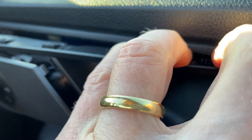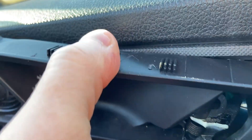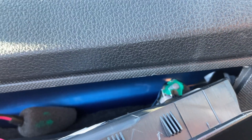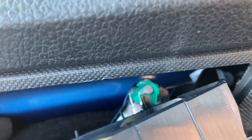Doing this one-handed. At this stage you can see there's a wire in here which the door handle is pulling from further into the door, and in there there's a connector. Sadly it appears you can't do it through this gap because way down there you're going to have to pull that out, so it looks like I'm going to need to take more of the panel off.